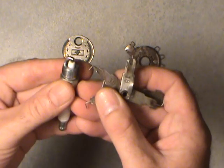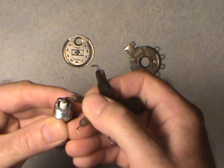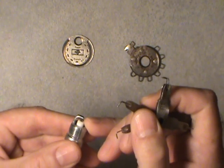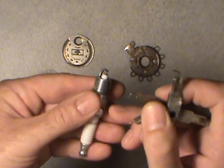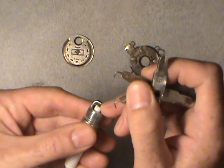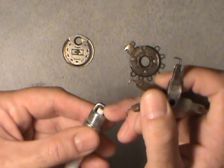Basically it's a pin-shaped affair — it's round, and it's the best way to actually get the most accurate measurement inside that gap. What you're trying to do is: the manufacturer for each given vehicle and engine combination will tell you what the right spark plug for that particular engine is, as well as the correct gap setting. You've got to get that gap setting to factory specs if you want your engine to perform at its best.